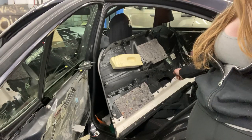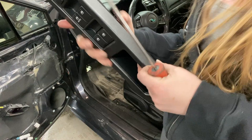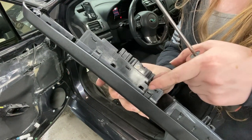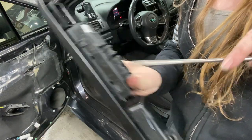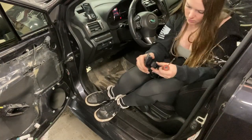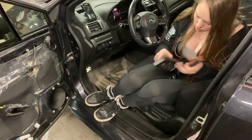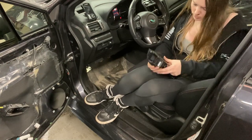These are the two screws for the driver's side master window switch. To take apart the window switches, you want to take two flathead screwdrivers and pry up on the tabs, but very lightly — be careful not to break them. There are holes that go underneath the window switch between the switch and the cover. I stick a flathead screwdriver straight through there to help me leverage the two apart.